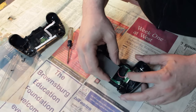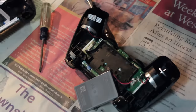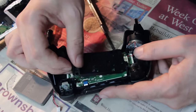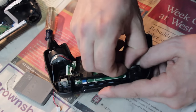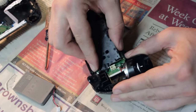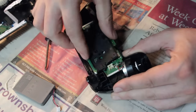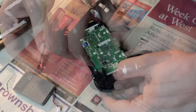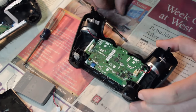After you have popped it open, you're going to find a screw underneath this black piece here where the battery is. So let's get the battery out of the way, and let's get this plastic piece — this cradle — out of the way. You can do that by grabbing on the sides here, just kind of pulling it out and then pulling it upward. You'll have to work a little bit on the other side as well. Just pull it away from the motherboard of the controller and then pull it off. It shouldn't give you too much trouble; if it does, just patiently work with it. It will come out eventually — they do like to give a little bit of a fight. Once you have that taken off, you can remove this screw right here.